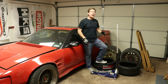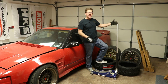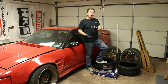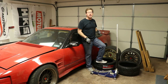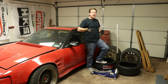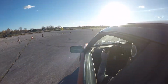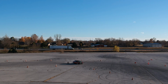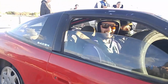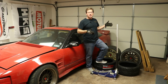And you really don't want to forget these guys, a couple of ramps of some sort, whether they're the blown plastic ramps, if you can find some low profile ones of those, or just build something out of wood. But you want to make it a little easier to get your jack up under the car and jack it up, especially if you decide to be a real badass and just drift until your tire pops, because you might find out when you get back to the pits that now that it's 2 or 3 inches shorter because the tire's flat, you can't fit your jack under the back jacking points anymore. So these are going to be our first steps.